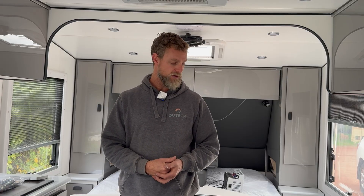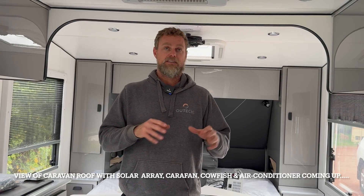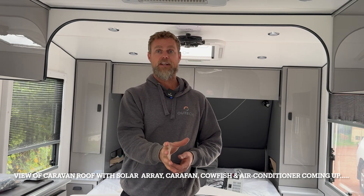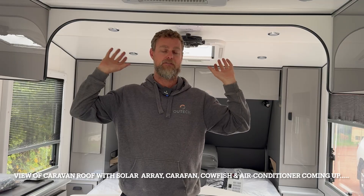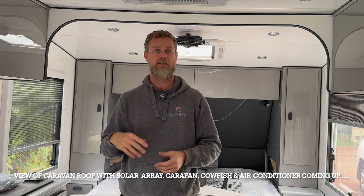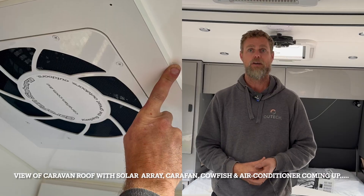This system, because of the size of the van, had a few complexities in terms of roof layout that we needed to consider when doing the solar array on the roof. What we've ended up doing is installing 1,000 watts of 200-watt panels onto one string, and then we've included two 100-watt high-voltage panels on the front slope of the van, which gives them a 1,200-watt array — completely taking up the entire roof space. The other thing we have installed on this van is a caravan dust suppression system.